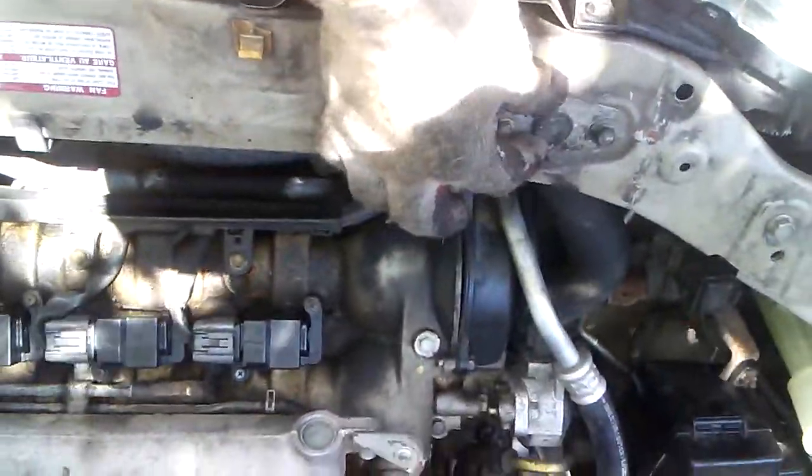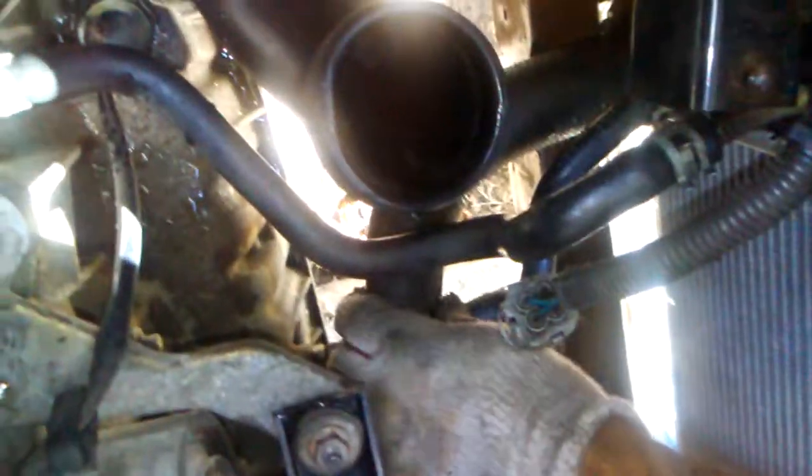If you're removing the radiator, best thing to do is take off these two bolts here, the brackets pop off. Then go ahead and loosen off your transmission lines — make sure you hold them up so they don't drain out everywhere, and plug them with something. There are two transmission lines, one and two, to take out, and then there's the main hose at the bottom to take off.